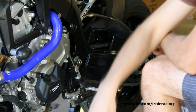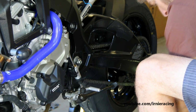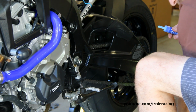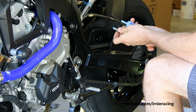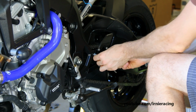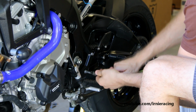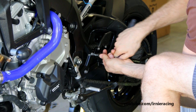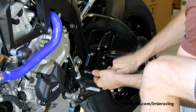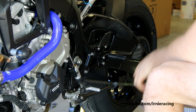It's not too heavy either. Much nicer. Very good. Okay, we're using these same bolts, but we're going to use Loctite. You have to use Loctite. This stuff. You'll always lose your rear set otherwise. Just a nice wrist torque. Of course, we have the Loctite, so it's not about too tight. Just tight enough. So I'm just using a little wrist movement, and that's it.